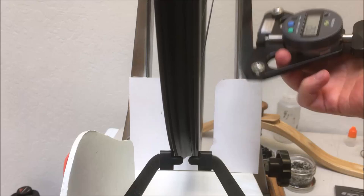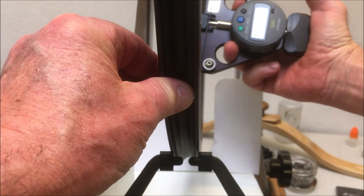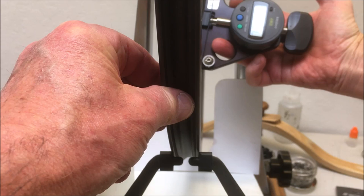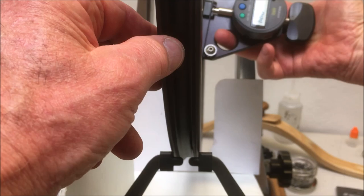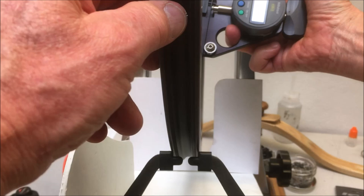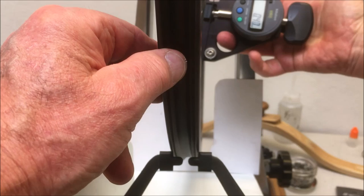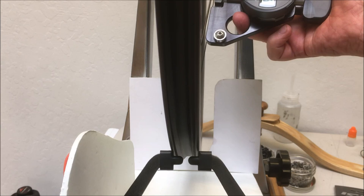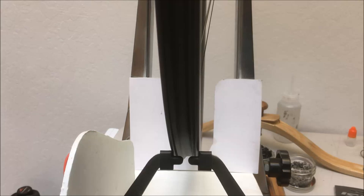Now the front wheel is in there. This wheel is round, this wheel is true - we would expect to see even spoke tension. We've got 37... actually about 31 if you do the math... that's 43... 44, 41 if you minus the 3 we started with. We're in the 40s consistently. These spokes are actually looser than the rear wheel right side spokes. I'd expect these to be a little tighter - the front wheel tension could have been a little higher.